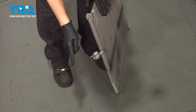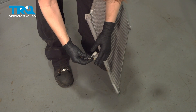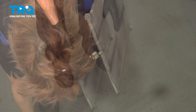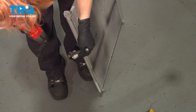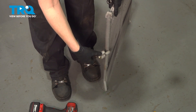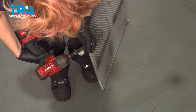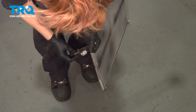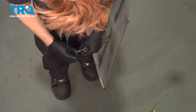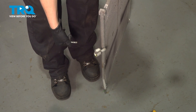We need these studs on our new condenser, so we're going to transfer them over. If your studs are stuck, a good way to get them unstuck is to put one of the nuts that came off these studs on backwards first, and then put the other nut on. Get a 13mm socket and a 13mm wrench. Hold the inside nut while you tighten the other one, and then you can unscrew your stud. Before you unscrew it completely, hold it still and undo the nuts, then take your stud out and transfer it to your new condenser. You can do this inside the vehicle or before you put your condenser in.